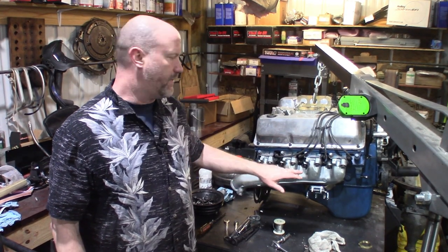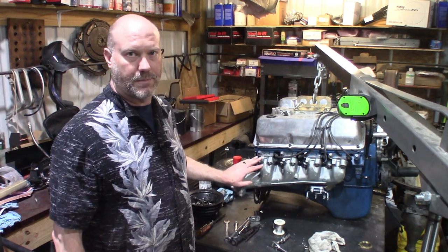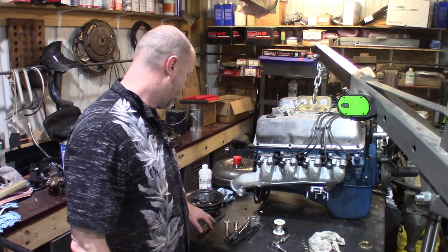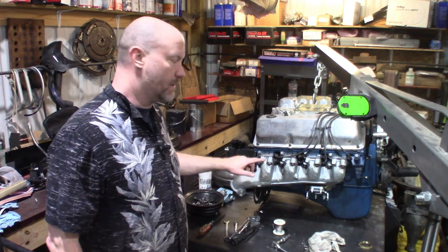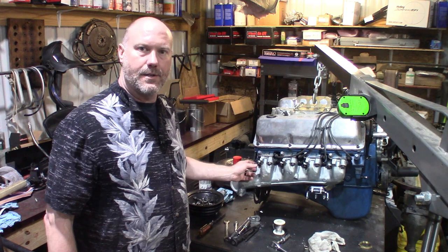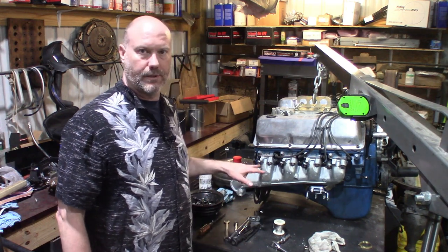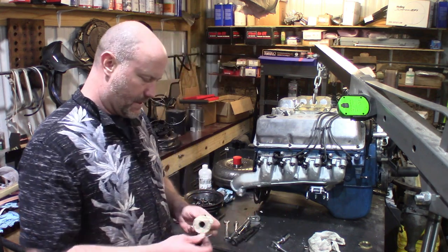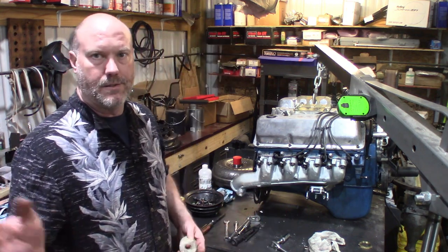All right, now we'll go ahead and we'll safety wire the rest of these. And like I said, this is not the perfect safety wire here. It looks like hot garbage. Looks like it was ate by a coyote, crapped over a cliff, you know, but it's good enough for my application. It'll stop the bolts from spinning. If this was real world aircraft, I'd be redoing that, but it's good enough for now. So let's go ahead and knock out the rest of this. We'll just speed up time.